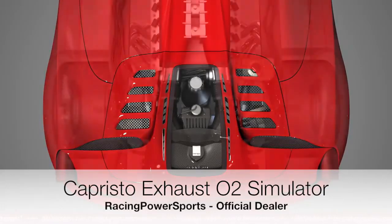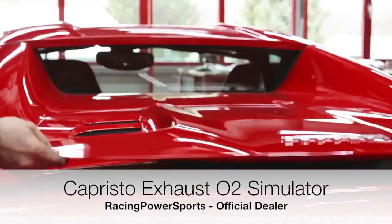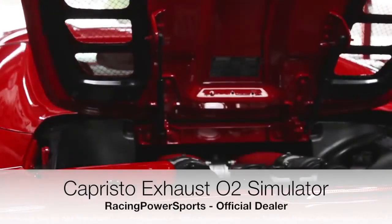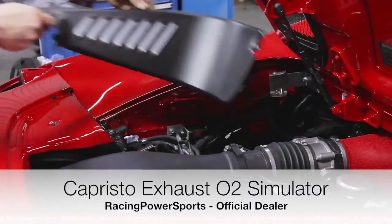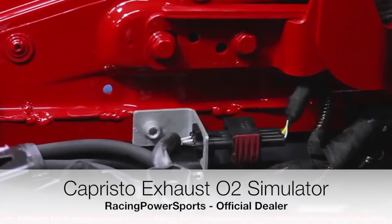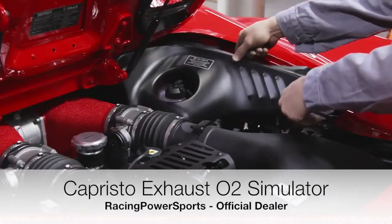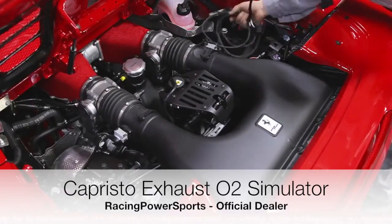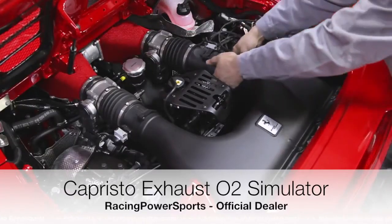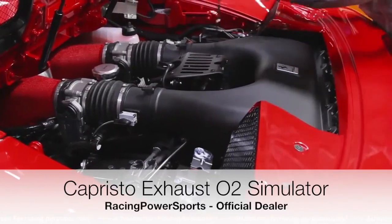In our example, the system is being installed into a Ferrari 458, which has lambda sensors and ECUs on both sides. In order to connect the system, we remove the side covers, under which the sockets for the lambda sensors are located. These sockets are opened and the cables of the CLS-1 are plugged in. By this, the lambda values run through the CLS-1 first, before they are sent to the car's ECU. The operational voltage needed will automatically be supplied by the new socket connection; therefore, an extra power cable does not need to be installed.